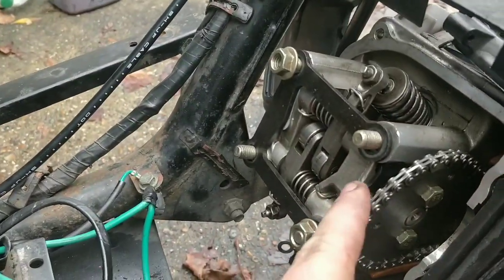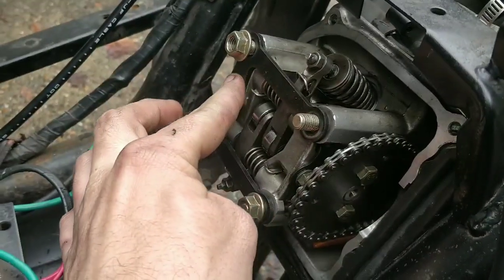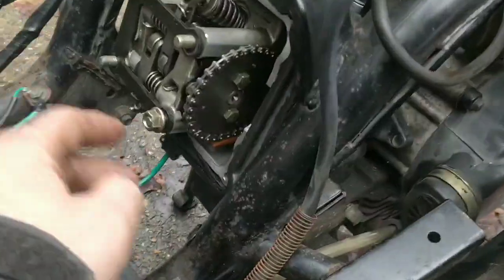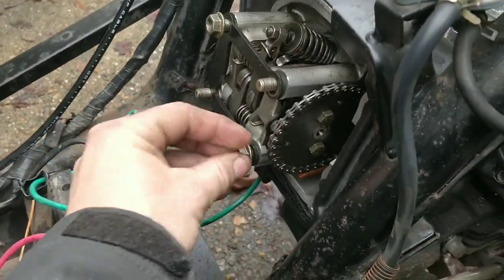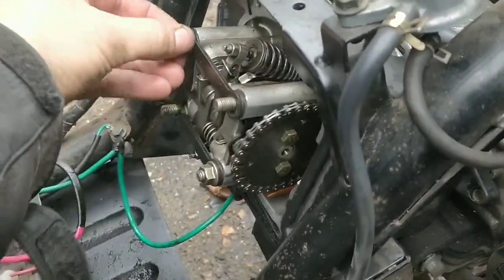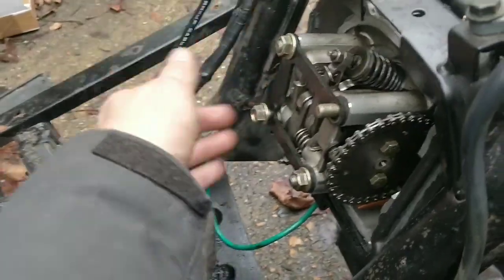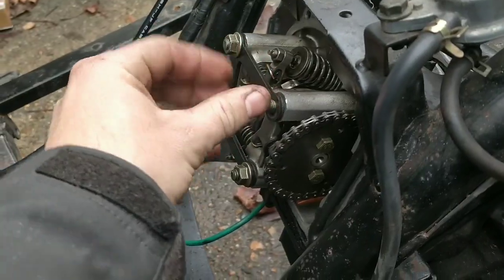Okay, guys, so you see this protrudes up, so it can't be that way, it has to be this way. Makes sense. Also, there's an oil channel there, which this kind of incorporates. So you couldn't flush it down like this, so a C-shape, when looking at the engine from this side. I remembered it being a U, but it doesn't fit, so it is definitely this C-shape. Same thing, torque them down, go by hand first, and then very gently in a cross pattern, like I already said. Don't go too nuts, guys. It's a Chinese engine. These things snap left, right and centre, and then you've done all the hard work for nothing. Be extremely gentle with everything you do.